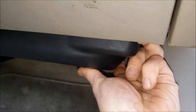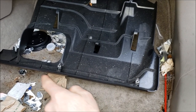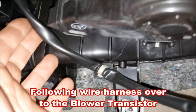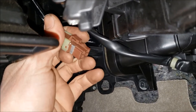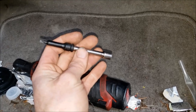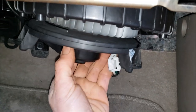Get your finger behind here and pull toward the camera — this whole panel should just click right off. On the back there are a couple of stays that go into slots here, and on the front it's got four clips that go into their appropriate slots along here. Now we have a clear view of the blower motor. Push this in, disconnect the electrical — follow that over to the back, push in where my finger is, push down, then pull back, and that slides right off. It's a four-wire connector; it shouldn't have any melting on it. Push down right here and that whole blade will slide down.